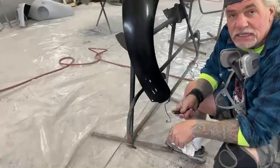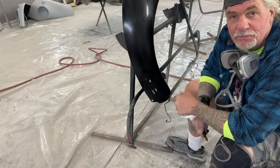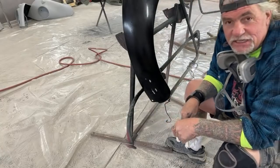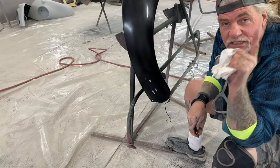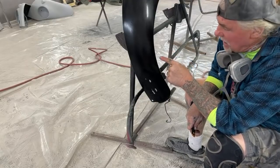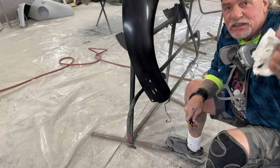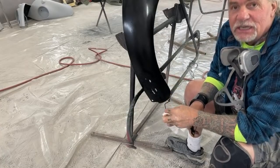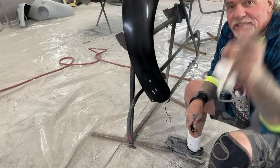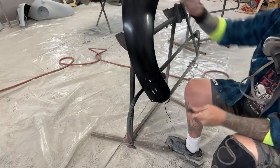What's going to happen is, if you try to remove that run after you put your three coats of urethane clear on, this is what's going to happen. You're going to end up painting the whole fucking fender. It's going to take you 2 or 3 days, because once the urethane clear is applied, you have added activator in that clear. You are not using your reducer and color blender anymore. Once the reducer in the paint and the chemicals in the paint itself hit that urethane clear, it's going to crumble and peel and ripple. And it's going to fuck up. So get your shit together and do it right the first fucking time. Because if you don't, you're going to pay for it in the end.